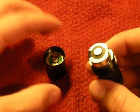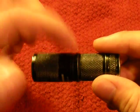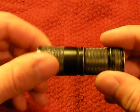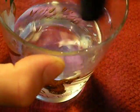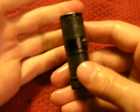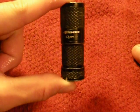So to recap: good batteries, check the inside for corrosion, check the back of the circuit board for any marks, keep your lens clean, keep your threads clean, and make sure your o-ring is in check. The o-ring is critical for waterproofness — mess it up and water will go right through those threads. Do all that and your light should last you many years. Thanks so much for watching — don't forget to comment, rate, and subscribe, and be sure to check out some of my other videos.